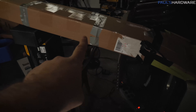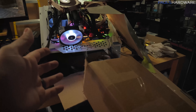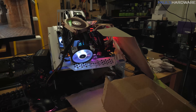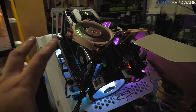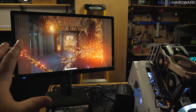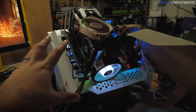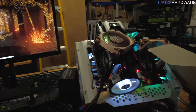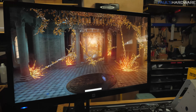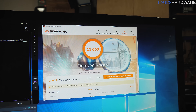This is my only portable AC unit, and it's tied into the back of the garage for exhaust. I set up this cardboard tube — completely hacked together with duct tape — to pipe cold air over to the system, which has been set up with more fans on it. I also have a supplemental power supply for one of the CPUs because I was getting very close to the 1,200 watt power limit. I did finish a test just now with a better score, and temps are way better — max GPU temp is 61°C.